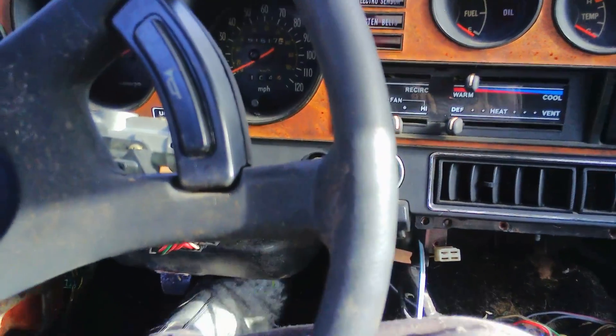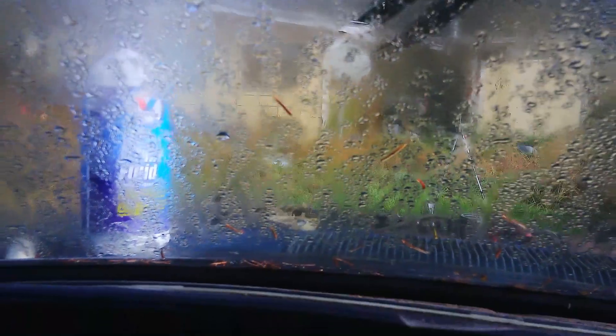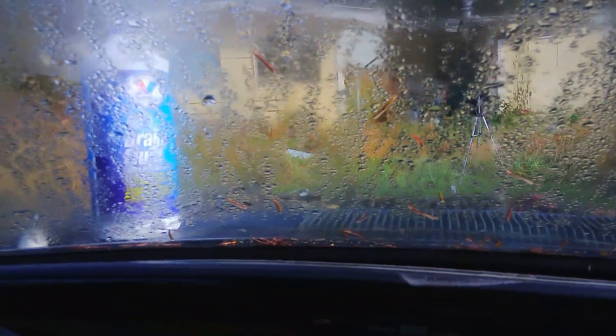The brakes — a little, a lot better. Uh oh — I've got fluid squirting. Usually when you get fluid squirting out of one reservoir and into the other, it's because the master cylinder's bad and it's transferring fluid from one circuit to the other.